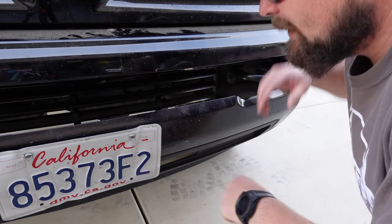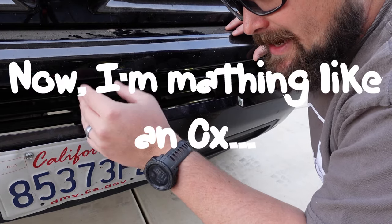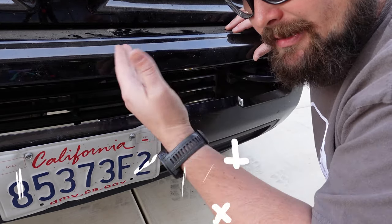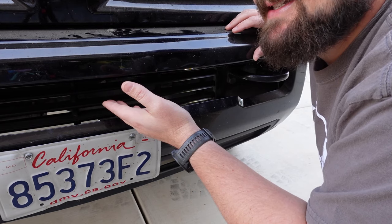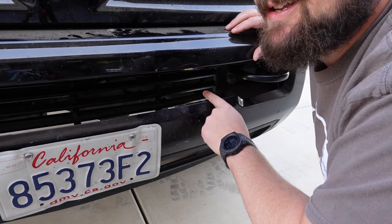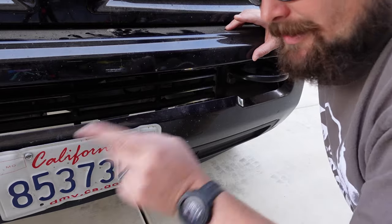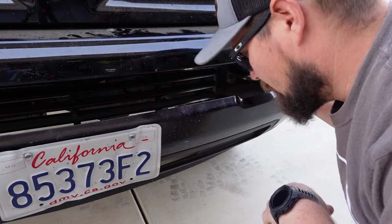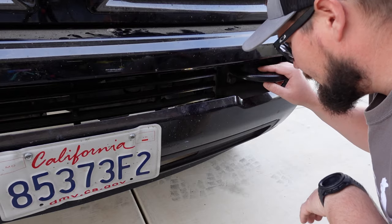I need the mounting to be 31 and 11/16 inches. So: 11/16 divided by 2 gives me half on each side. I round up to 12/16, divide by 2, that's 3/8. Since I went up 1/16 to get there, I divide that by 2 and subtract 1/32 from 3/8. So three-eighths minus 1/32 on the tape measure is what I'm taking these down to. If you have a better way of doing that math, put it in the comments — that's just how my brain works.